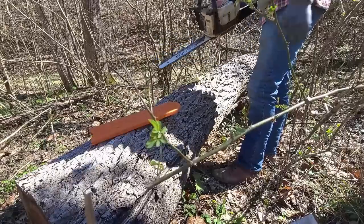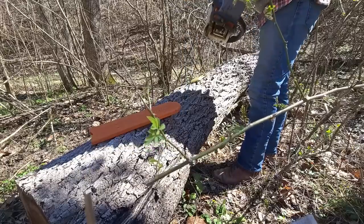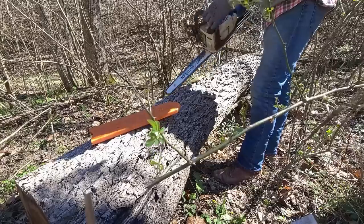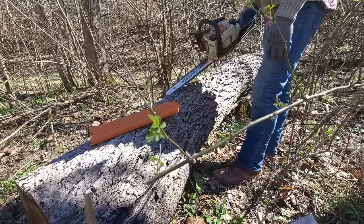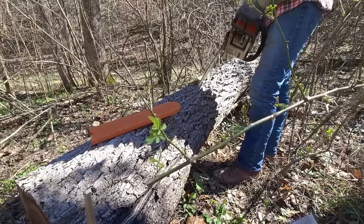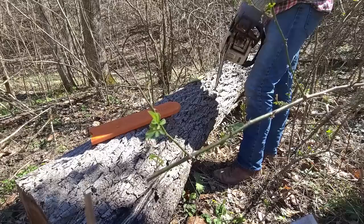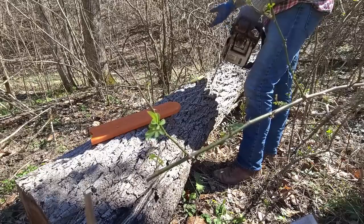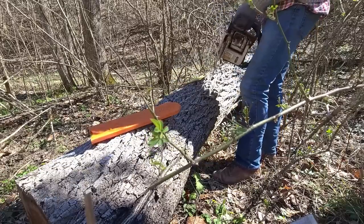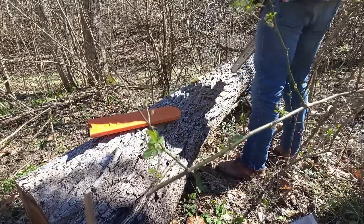The other problem with this saw, it's not running correctly. This is one of those EPA saws. You know, you can't adjust the carburetor. So I really got to clean it out. It's running weird low. I have to constantly give it a little fuel. It's not the idle speed. I just have to give it a little fuel for its low. But once I open it up and it's running high, the saw is perfect. It's just the low side of the carb is kind of screwy. But anyway, let's go.